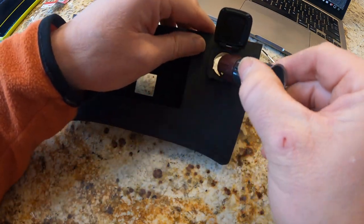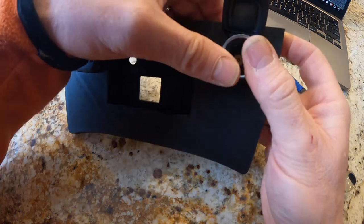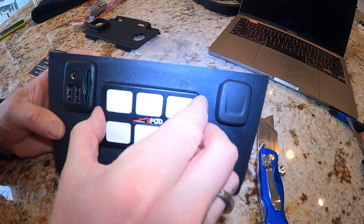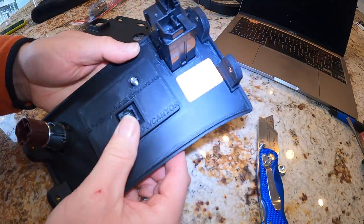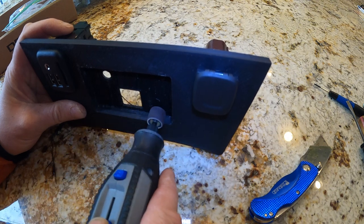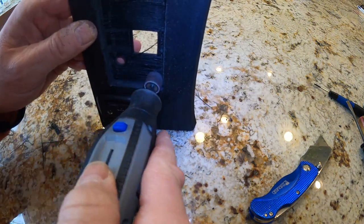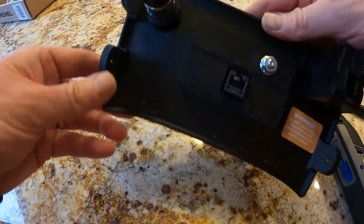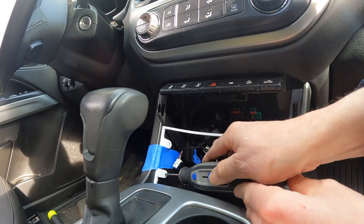Take the 12-volt lighter from the truck, place it into the panel — there are a couple of notches you have to line up and then it slides in pretty easily. Next, the sPOD control panel goes into the face panel, but there's a problem: I couldn't fit it in. I had to remove plastic from the inlay of the face panel using a Dremel tool — there was quite a bit of plastic to grind off to make the sPOD instrument panel fit. Keep that Dremel out because you'll also need it to fit a drill bit into the frame for drilling the four holes.